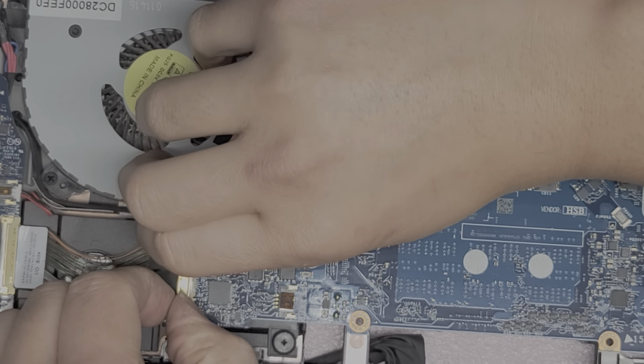And now we're gonna remove all the screws from the motherboard or the logic board, whatever you wanna call it. Okay, so let's remove these screws. Again, try and keep them in order. So we got one in this corner. They actually put an arrow there to help you. So they are numbered, it looks like. This one has a 5, okay. So I guess we'll remove the 5 first. There's a 4 here. We'll remove the 4 next.